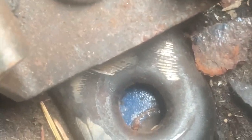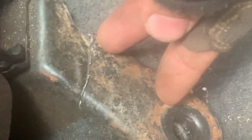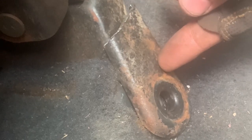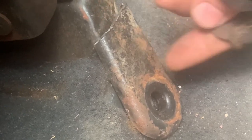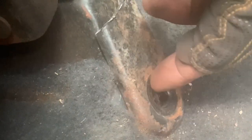Let's trial fit it. Okay, these rear holes - that one's in, that one's a bit short so I'm going to have to cut that off, extend it and go from there. Okay, this front mount - the only way I'm going to get this hole to line up here is to overlap this and weld it on there. That's due to the angle it sits on, so it's got to sit on the front of there to get that distance forward. That's fine, I'll scribe that up now and weld it on.